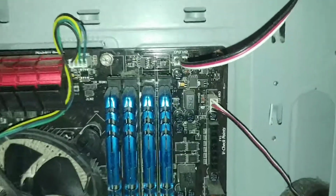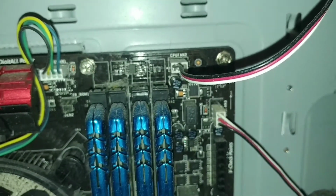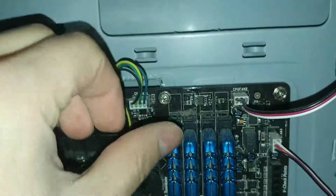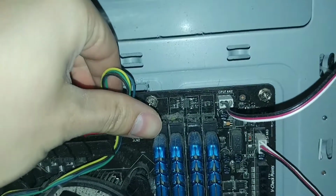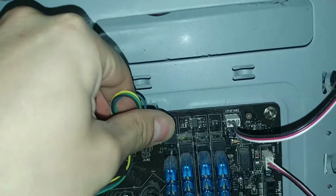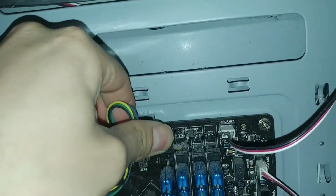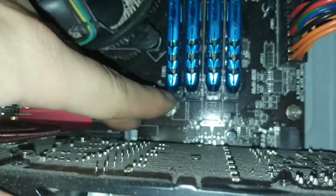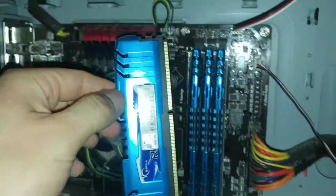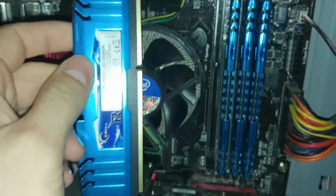And so to uninstall the RAM, you can see there's these plastic tabs up top. And let me get a better seated position here. But when you're pulling these out, all you have to do is it's a combination of lifting up and pushing back. So I'm just kind of lifting up and pushing back. Okay. And then on the bottom, angle this down so you can see it. Use my pointer finger and do the same thing. Okay. And once I do that on both of them, I can wiggle and slide it out. Okay. And that's all there is to it for taking them out.